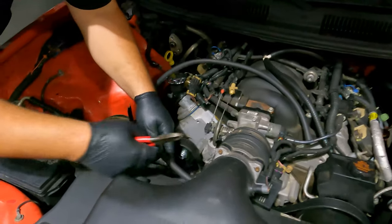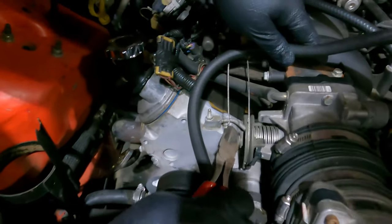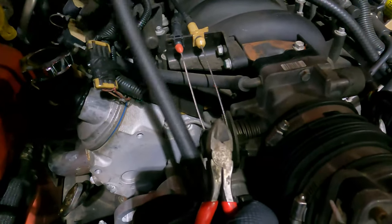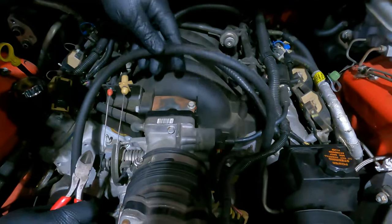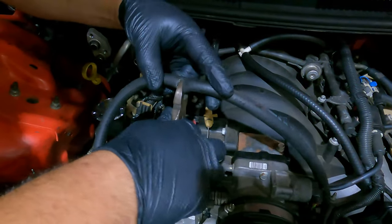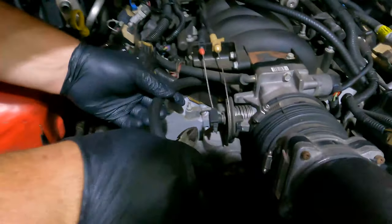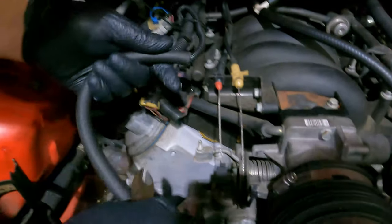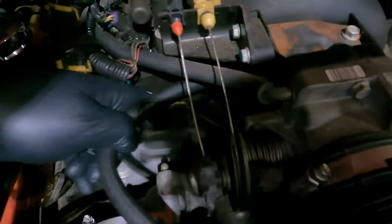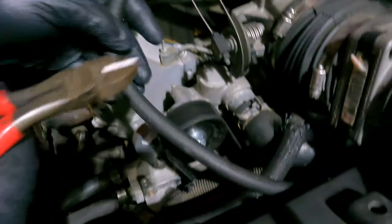So I'm gonna run it just where it's currently at, but I'm gonna loop it like this and do just a little soft 90 into the intake manifold right there, because I can use this other remainder of hose for something else. I don't have to have all of that. So I'm gonna just eyeball it. See if that'll work. Let's see here. All right. So yeah, I got a little extra there so I can cut down some more. There we go. Yeah, that's better. See, I can't have too much going though because I'm gonna hit that pulley. So I gotta cut it just right.